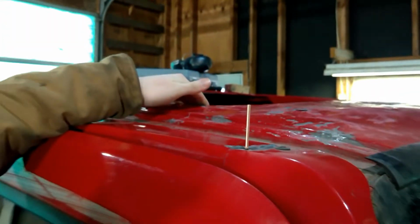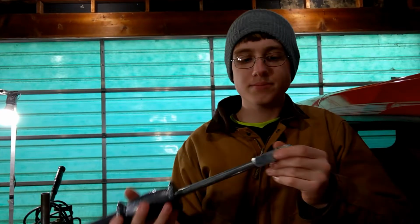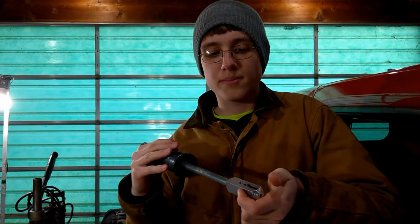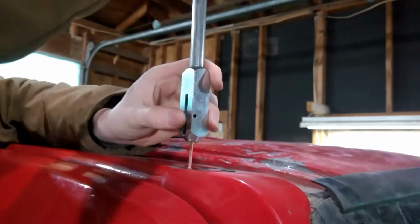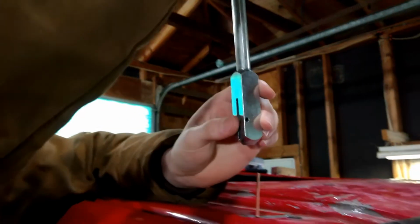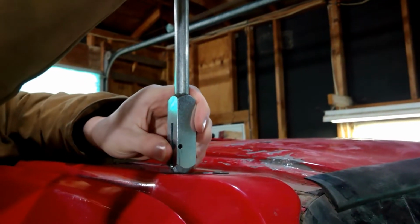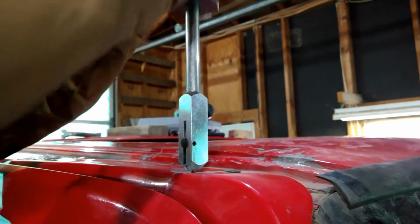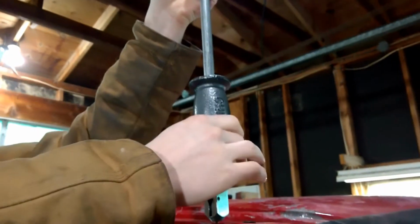And then also included in the package comes this slide hammer right here with this little locking wheel mechanism on it. So basically, what you have to do is take this, sit it on top of here, and then roll the wheel. If you roll the wheel, you can see how it goes in and out. You turn it so it's facing outward, so it slides over it. Then you just push the wheel back in and pull up a little bit, and then now it locks it in place. You can use a slide hammer and watch the dent down there pull out.